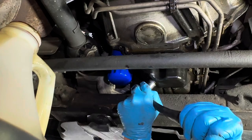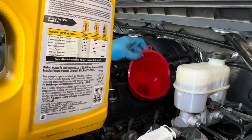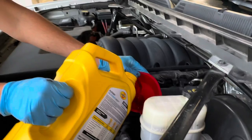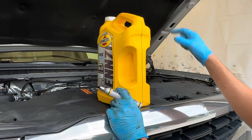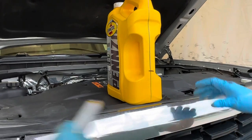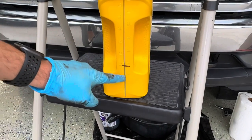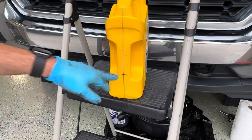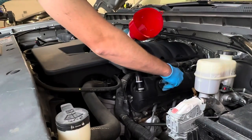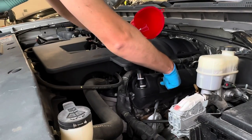We're just going to tighten up our drain bolt, make that nice and snug. You need a larger funnel because this is on an angle so it's going to tip a little bit — have the wider part face like that and then just pour. I'm just going to pour in our eight quarts. I have my first five quarts in. Since this has five quarts total I want two left in this jug, just marking there on the jug. Our oil level is just above the line so we'll leave it there for now. I'll start it up, check the oil, and then we can use the rest to slowly top it up if needed. We probably didn't get 100% of the oil out, so we got just about eight quarts in. Put our oil cap back on.